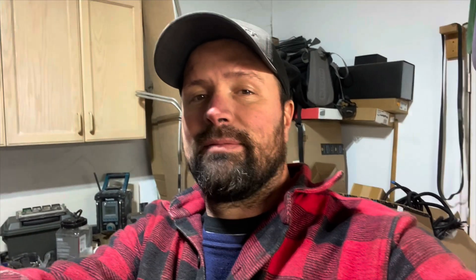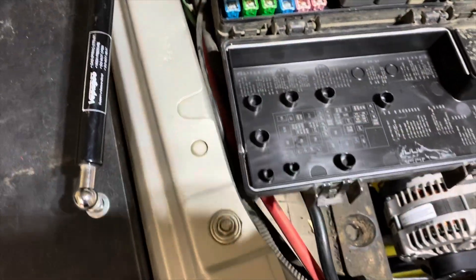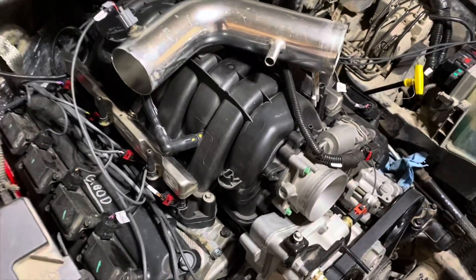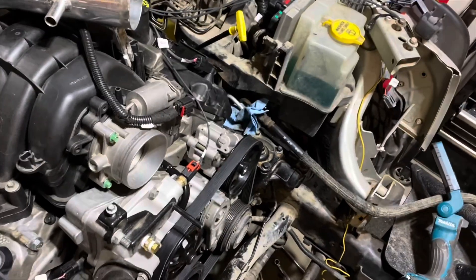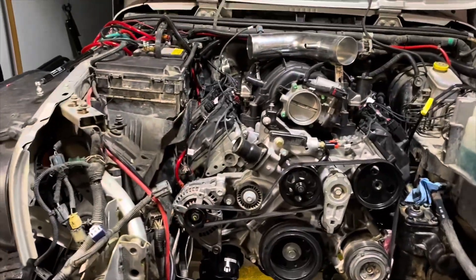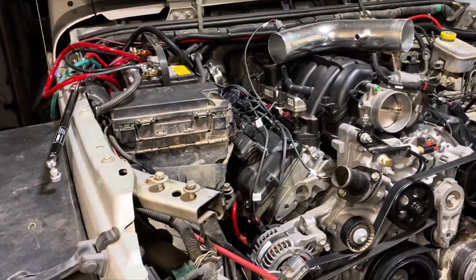I still got the family and stuff, so we still try and go out and do fun stuff — got to have a life balance in there too. But I think later tonight or tomorrow morning, I'm going to fire this up and you guys are going to be along for the ride. I pulled out the fuel pump because I don't want this thing getting fuel right now. I just want to prime the motor because it's been sitting for a few years, so I want to make sure I can get some oil up into it before we start her up. So let's turn the key for the first time and see what that looks like.